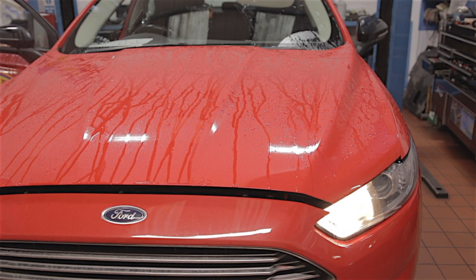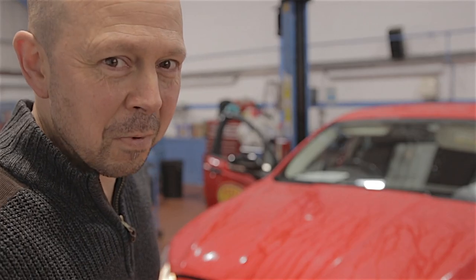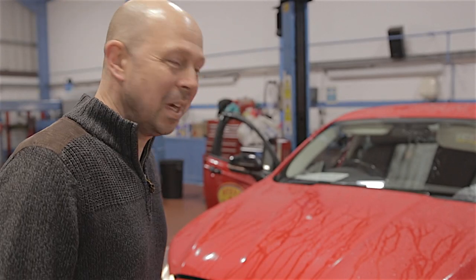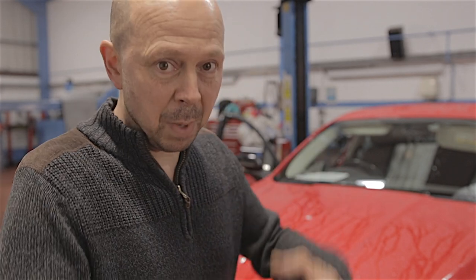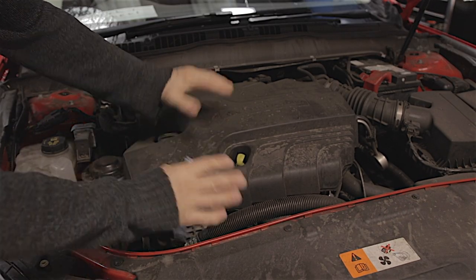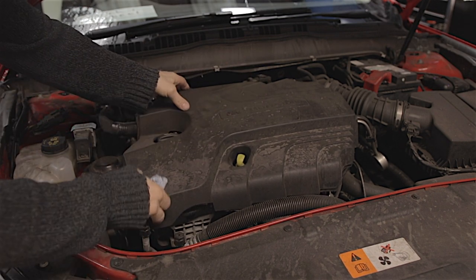Can you hear it? It's nice isn't it? I get the feeling the flywheel is almost about to jump out of the bloody gearbox casing. I'm going to have to take this gearbox out and show you how I change this clutch, and I'm hoping I can actually get this flywheel off — I need to see what condition it's in because the bolts might be covered over. This is clattering like bloody hell.